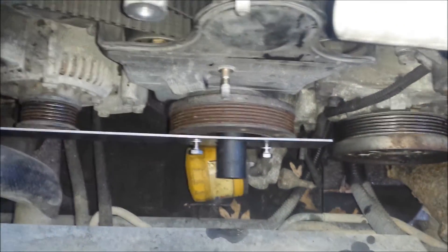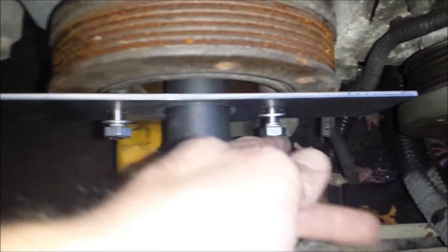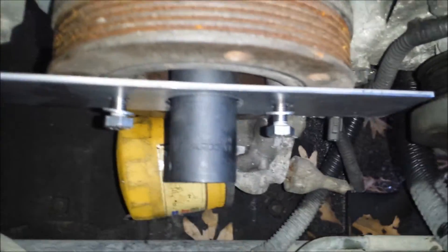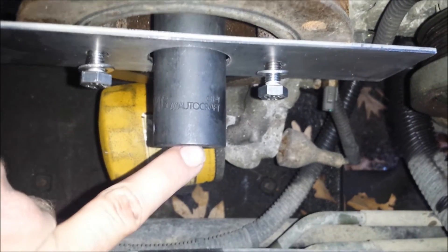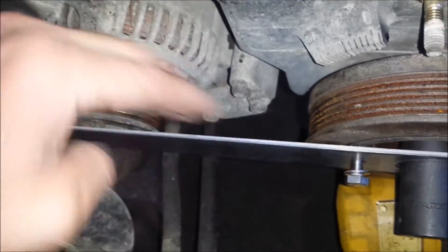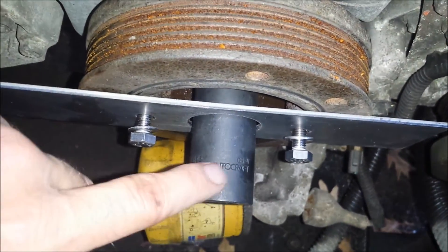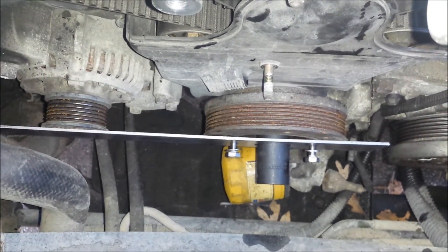I've got the tool in place, resting on the frame over here. I've got the two bolts started in their threads — I ended up putting the socket in its hole first to hold the tool in place, then hand-threaded the bolts. Now I just need to tighten them up. The idea is to put a breaker bar or large socket on here, turn it counterclockwise — the tool we built is going to try to turn that same direction, rest on the frame, lock the pulley from turning, and then the nut will be able to spin independently. This took me maybe 30 minutes and about 15 bucks in materials.